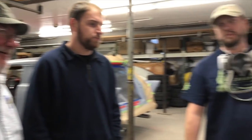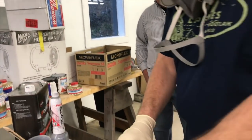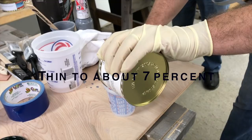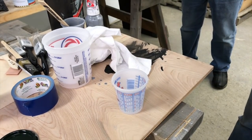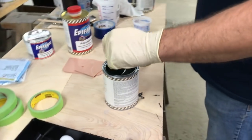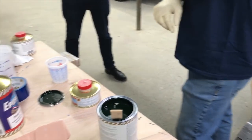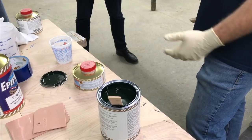Because of the temperature conditions in the workspace, Jason decides to thin to about 7%. He notes that you should get full coverage in one coat, though you may need more. You can apply as many coats as needed, but it's best to do at least two — especially over bare primer, where you'll likely need two coats for a quality finish.